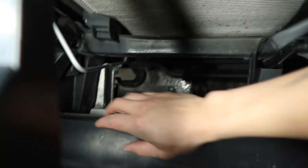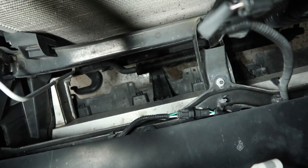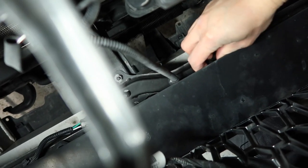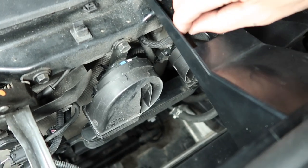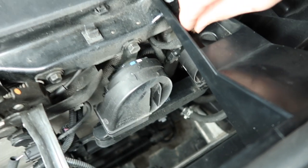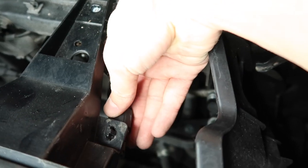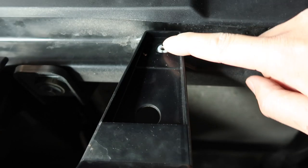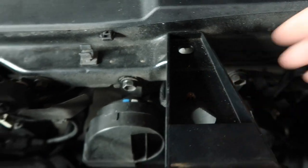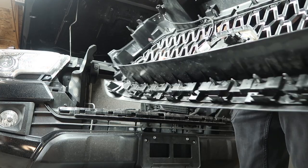Once you have those all popped, you can go ahead and remove it with your hand, just like that. There's going to be this little tab right here that's holding this wire on — just pinch that and then push it down. Or if you need a set of pliers, you can do that as well. Once you've pushed that brown clip down, go ahead and unplug the wire that's connected to it. In order to pull the grill out, you see these little clear things where the screws were — we're just going to pull it over that, same for this one. Now you can pull off the grill, just like that. Comes off super easy.